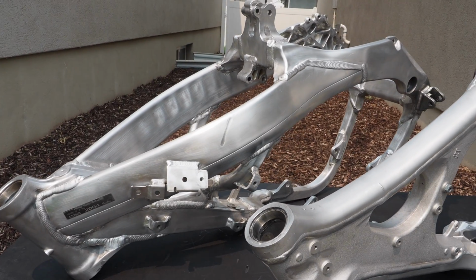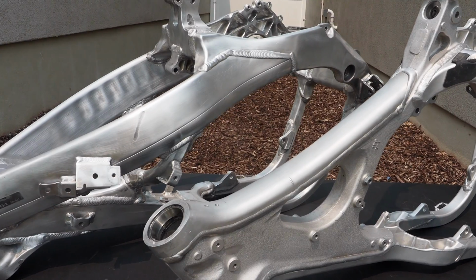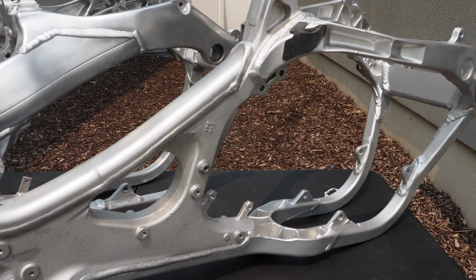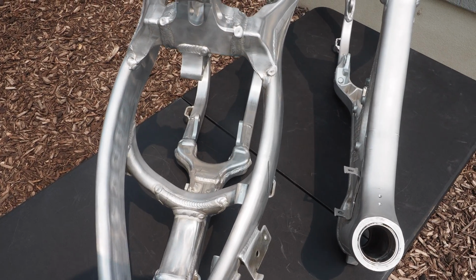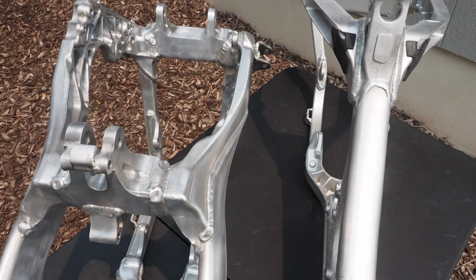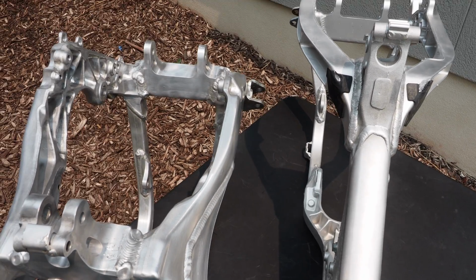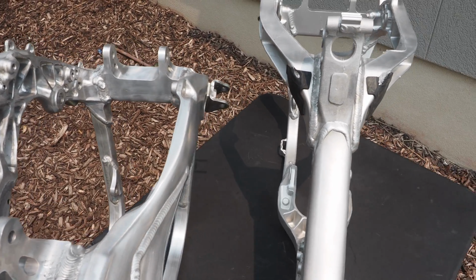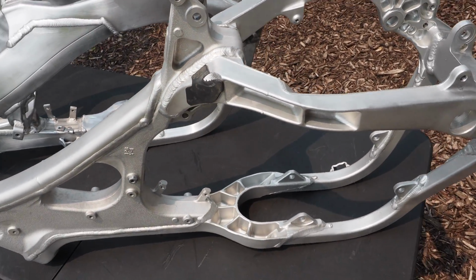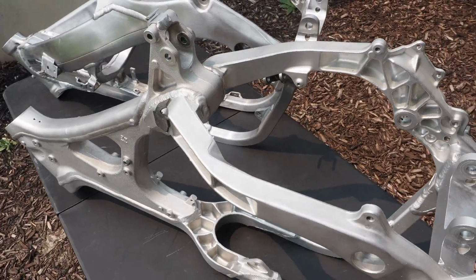Okay, we are outside checking out the comparison between the old school version of cleaning up an aluminum frame compared to vapor blasting on the YZ. I gotta say, I'm stoked about how both of these came out. What do you guys think? The CR has the aluminum cleaner with some PRYME wheels and those wire brush heads for the Dremel, and then the YZ frame is just all vapor blasted. It's really hard to tell which did a better job.